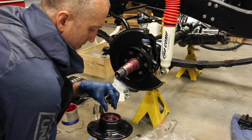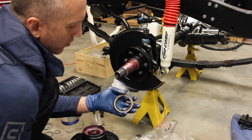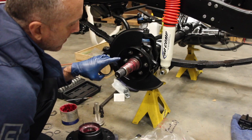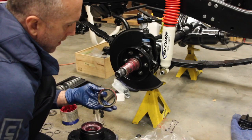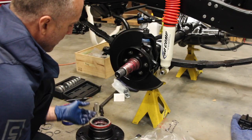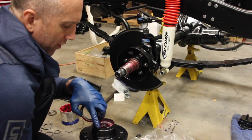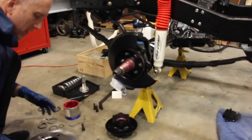Drop the inner bearing in, then take your oil seal — bearing seal. Take a close look at your seal because it has a lip on both sides, but only one side is the proper way to install it so that it seats over the top of the wheel spindle. The side with the larger lip should be facing inward — basically outwards from the inner part of the wheel hub. Use your bearing seal press and tap it in. Get it level with the lip of the hub — anything further and you start pushing down into the bearing. Once the wheel hub is cranked down, the seal will seat itself properly.